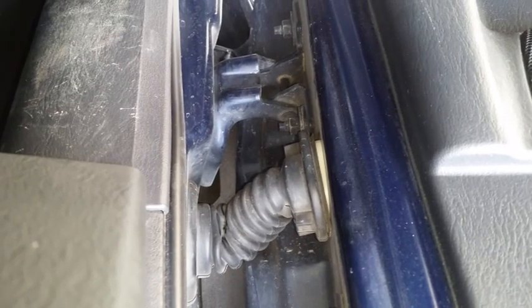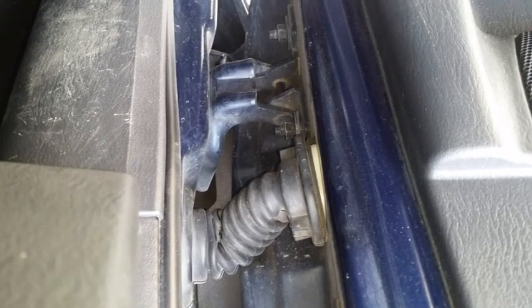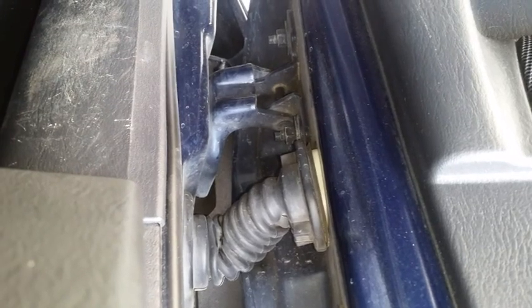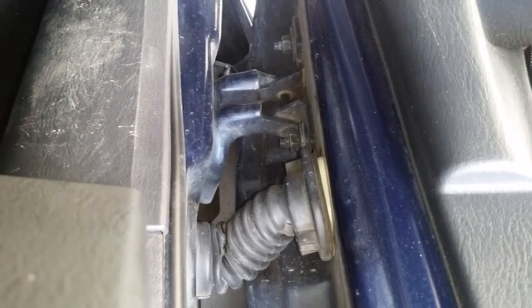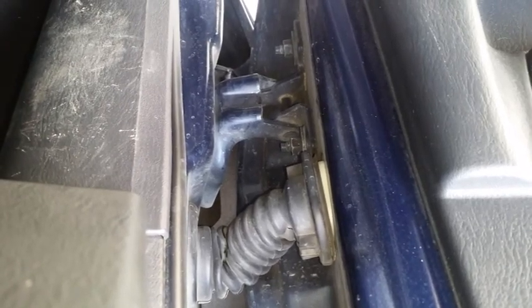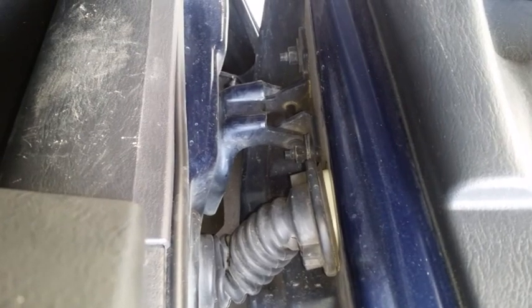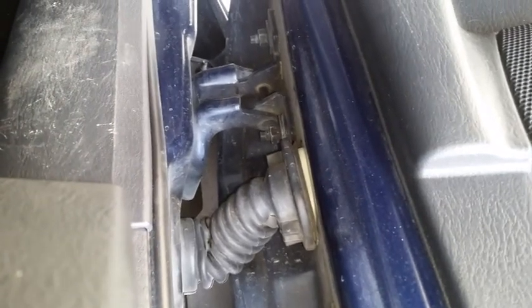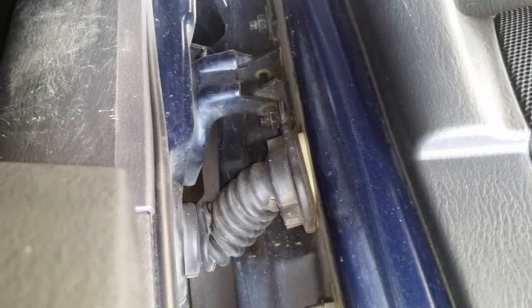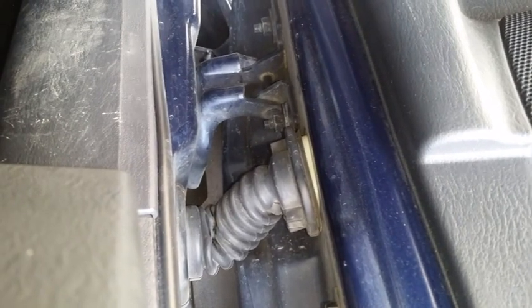Especially on the driver's side, if a wire goes bad, especially the main 12 gauge power wire and the main 12 gauge ground wire, if either one of those goes bad, you get a door open indicator when it's really not open. You get lights coming on inside the cab when they're not supposed to be on. Electric windows don't work. Door locks don't work. It's just a big deal. But all this is probably one broken wire, maybe two. And if the little smaller wires break, you may lose things like the mirror adjustment and the speakers.